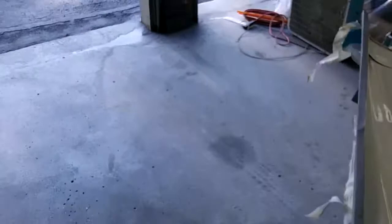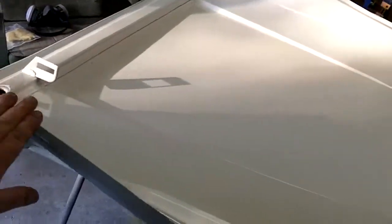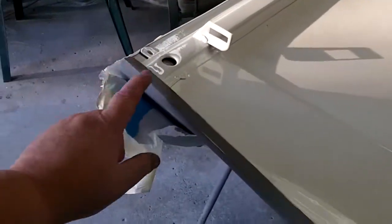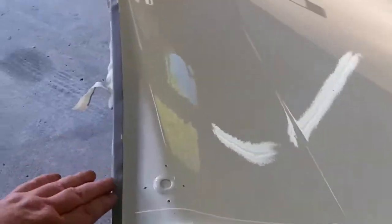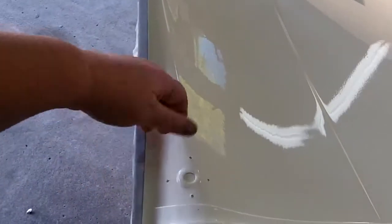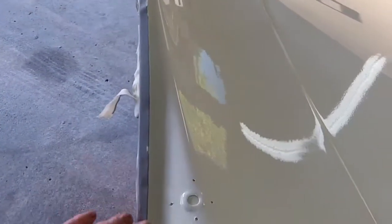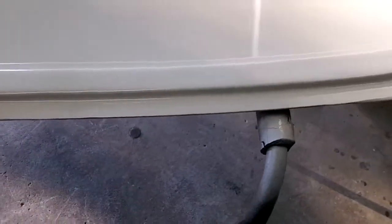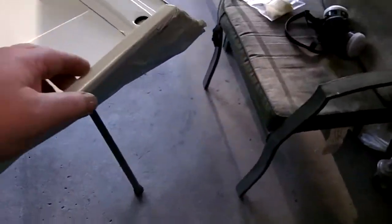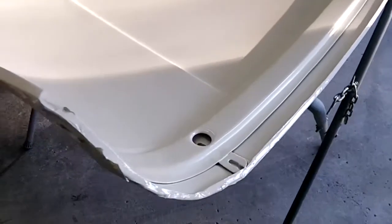Just taking a look at the underside of the hood this morning. It looks good. Just unmasking, and what we're going to do today is we're going to paint the top side and these bottom edges. That's one of the challenges I have — trying to figure out where I want to mask this off so it's not to get a clear line. So I figured what I'll do is I'll just tape on the inside of here and then we'll spray up from the bottom just to make sure I get this covered. I've also taped it along here just on this seam, so I figured that would be a good area to stop as far as the tape is concerned, and then we'll paint to here and clear to there and we'll tape off the back side of this edge. Hopefully that works out okay. It's a challenge for me to figure out how I'm going to do this sometimes. I guess I'll figure it out eventually with some practice.